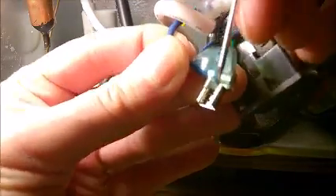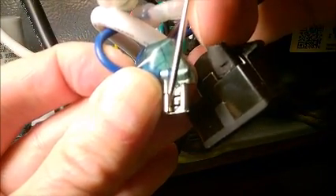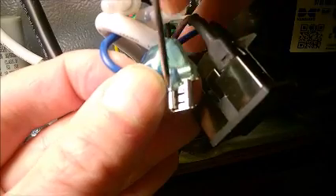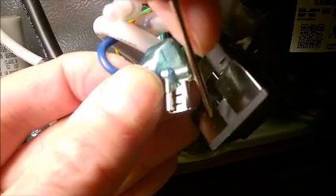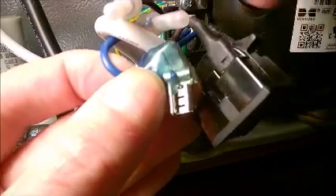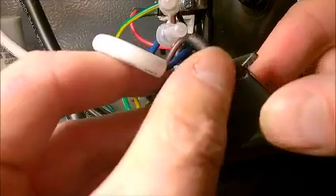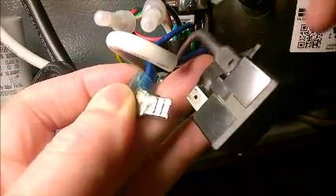Let's look at the connector structure. There are three tabs: a bottom one, a middle one, and a top one. The middle one is the one with the locking pin. What I did is push that center metal tab strongly backwards to have the pin release from the hole. Now these other two connectors are inserted the opposite way.